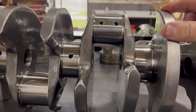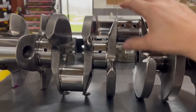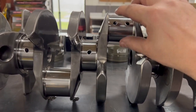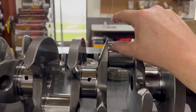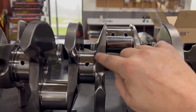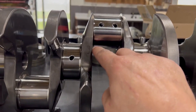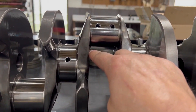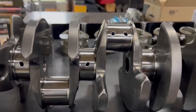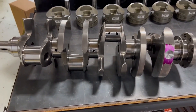On great big 1,000 cubic inch or 959 cubic inch engines, they are crankshaft breakers - it's just the nature of them. You move the rod pin way up here and there's just not much material, no overlap in that area. On my 4.125-inch stroke crankshafts, the overlap goes way down here - it keeps getting stronger the less stroke you have, but we need cubic inches.